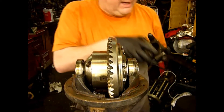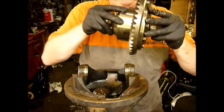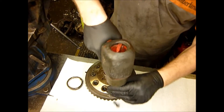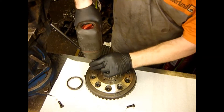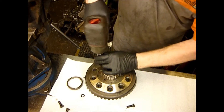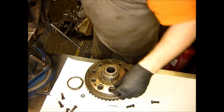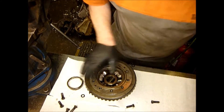Right, now the compressor's shut off, we'll take the carrier caps off. We'll take out the special adjuster ring — I should now lift the centre out. We're now going to pull the crown wheel off — and here we go. Not very tight. In fact you can see these are all wet, which indicates they haven't been loctited. Okay, now lifting this off and taking that gear out — there's the ARB unit.